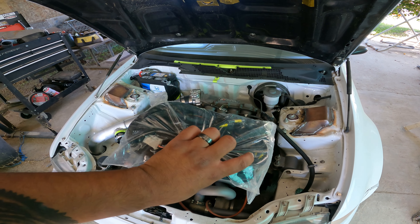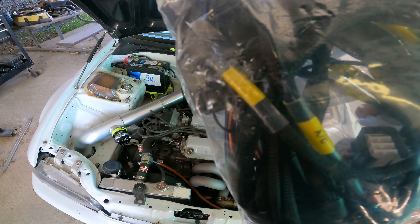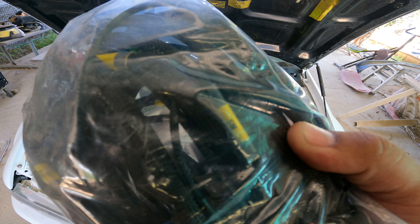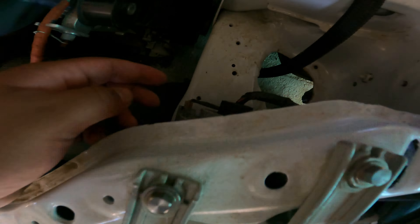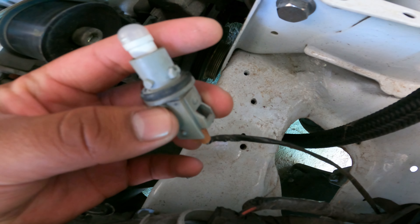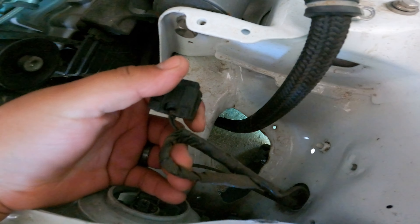So this headlight harness, I ordered it from Carrot Top Tuning. It was about $360 - not sponsored by them or anything like that, paid full price. So I took a look at the harness and so far I really like how everything is. Everything is labeled. As you can see, that's for the AC, that's for the side marker, there's one for city light, you can see it says SM for side marker. I do have Euro spec headlights and I have crappy little spade connectors, so having that harness, those connectors will go straight in, which is going to be great.